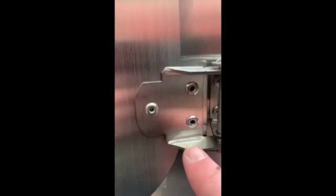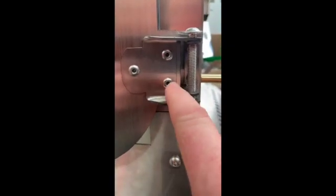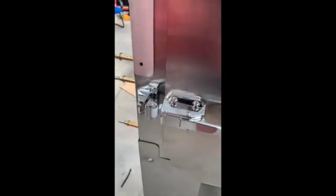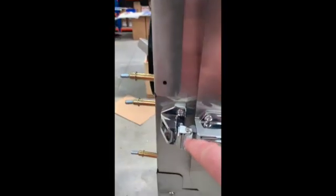You've got bolts that pop through to hold it onto the other section of the hinge. You've got two of these hinges in the kit — one with straight holes and one with elongated holes. We suggest the straight holes: pop rivet those onto the bottom of the door. Close the door with the catch, align the catch, and move the door up so it aligns properly. Ideally you want the catch a couple of millimetres higher up — to the top edge of the catch. You have the elongated holes on yours.